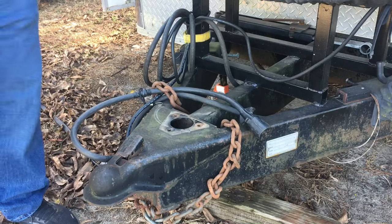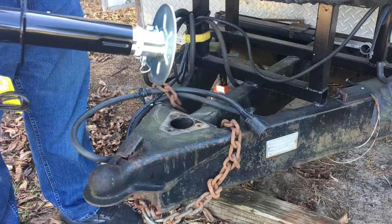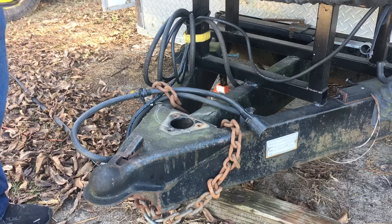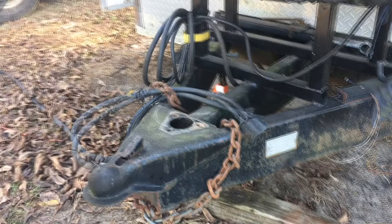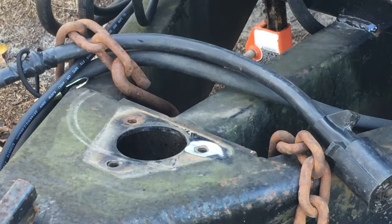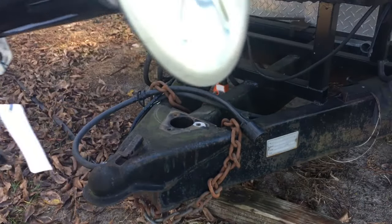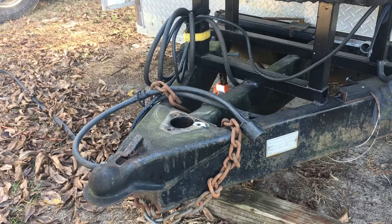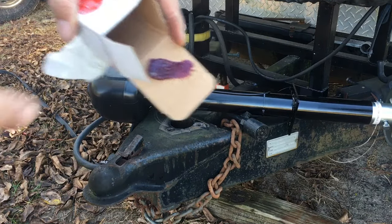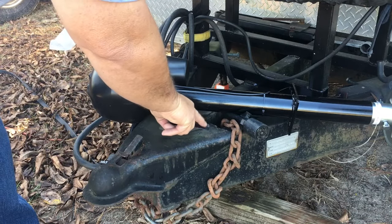What we got here is I made me a ground wire, just gonna go under one of my bolts so I can run it to my battery on the inside. We're gonna clean the bottom up where the bolt goes - let me get my grinder. I ground around that bolt, got it clean. I'm gonna put a little grease on it so that way it don't rust and it'll continue to have a good ground. Just put it all around your bolt hole to cover that fresh metal up.